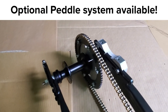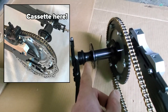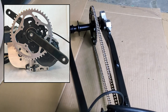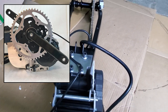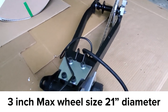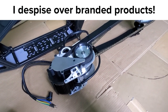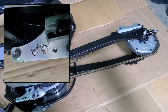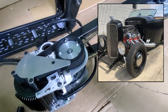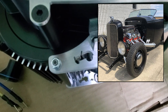I'm not going to have the pedal system with the bike I'm building, but there is an option for this kit to run an independent pedal system with its own chain. There is a point to mount the derailleur and Mike has other hubs that allow for a regular 10 speed cassette — so no electronic power system, you just get to pedal along at motorcycle speeds should you wish to. The maximum tire width at the back is 3 inches and the swing arm itself is long enough to accept a 21 inch wheel size. One of my favourite details about the motor is the subtlety of the branding — you have to really look for the LR logo but you can find it on the rear sprocket and the lower part of the motor mount. The logo is of a 1932 Ford Roadster convertible, which is one of the original hot rods cruising the roads in the USA during a golden era of motoring.